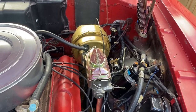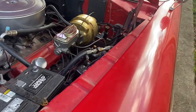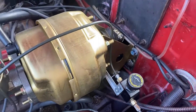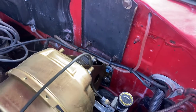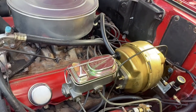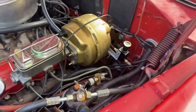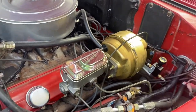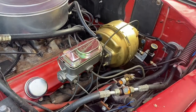Being that they sold it together, it's for a 1970 Plymouth Satellite — one of the B-bodies. Comes with the booster, comes with the mount bracket, that rubber boot, the little clevis pin, the washer, cotter pin, all that — all the way down to where it connects to the pedal. I got it from www.getdiscbrakes.com. Just tell them you're ordering it for a '70 Plymouth Satellite. Don't tell them it's for something else — they might not want to sell it to you.